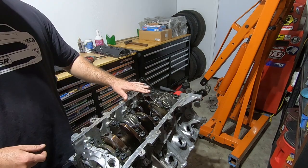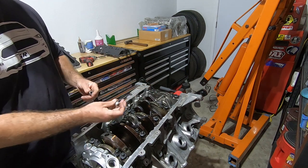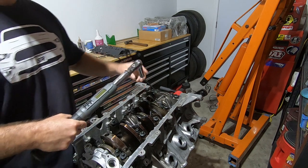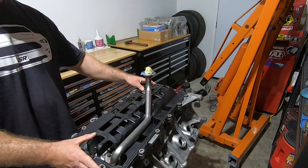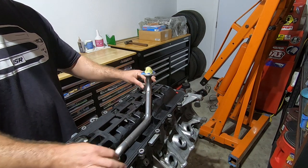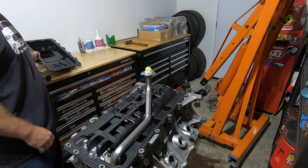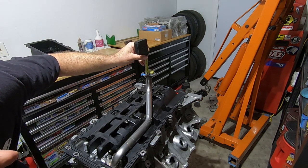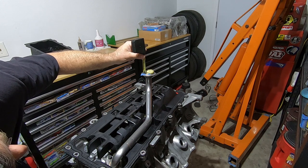We're at about a half an inch, so I want to come down a little bit. If I need less space in this position, I don't have to come up with the pickup tube — I got a little half inch spacer to put on there. You could use M8 washers if you want. I'm going to torque that to 20 foot-pounds. I got the windage tray back on, the pickup tube back on, put a little bit of oil around the pickup tube o-ring, snugged the bolts down, put the oil on there just in case this is the last time it goes on. Checking clearance one more time — that is right at just under a half an inch, which is where I like it.